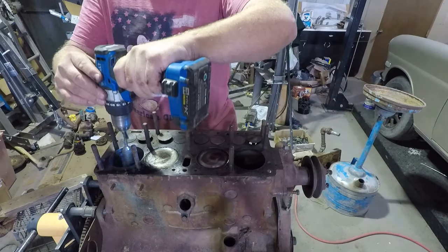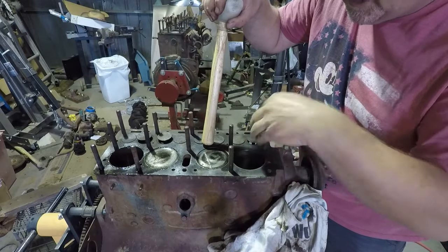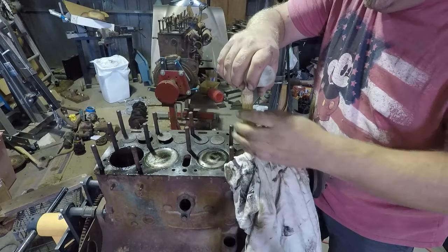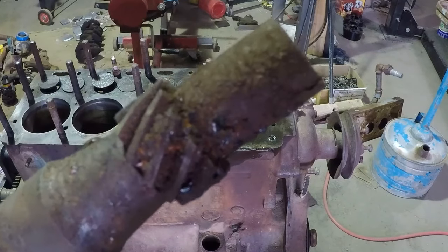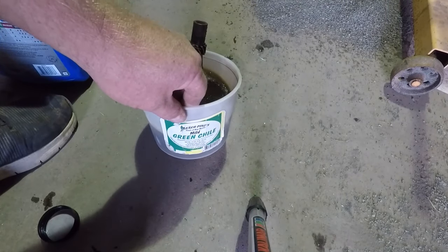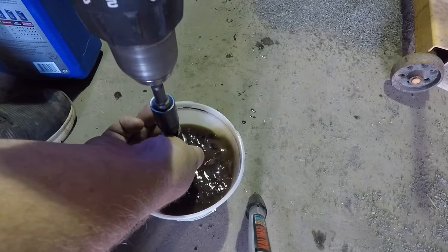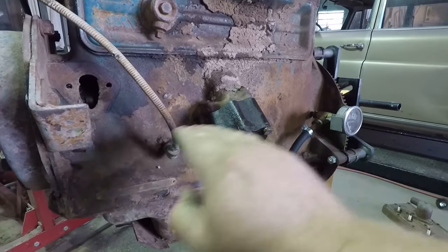Anything good down there, or just rust? I need to clean all the way to the bottom of that cylinder, and there's absolutely no way this hand is fitting in that hole with a rag. So what I'm going to do is shove a bit of rag down there and then use a wooden stick, butter-churn style, to get the walls clean. There's the oil pump out of that rusty F-head — let's see if we can reuse this. Employing my green chili oil pump test rig. Got the oil pump in there. Lots of oil — that pump should be fine.